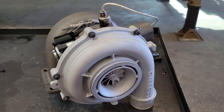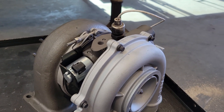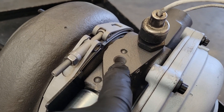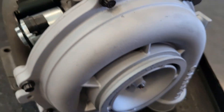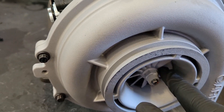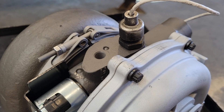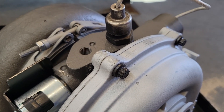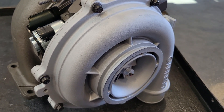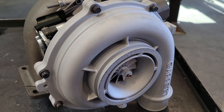I'm going to give you a few tips on what to do before you fire this thing up for the first time after you get it bolted on. Once it's bolted onto the engine and most of your hardware is hooked up, go to your oil inlet and fill it with new clean engine oil. Spin your compressor wheel a little bit to make sure it coats all the bearings on the inside, then top it up again. Hook up your oil feed line, but you're not quite ready to start it yet. Disable the fuel system first so you can crank it for a good 15 seconds, or watch your oil pressure gauge until you get full oil pressure.